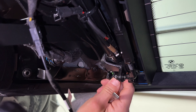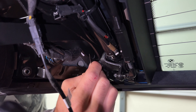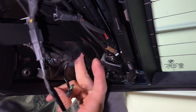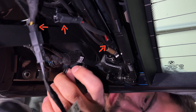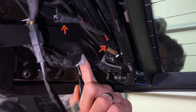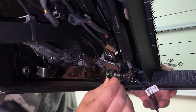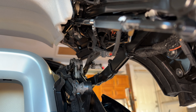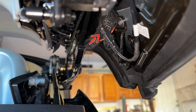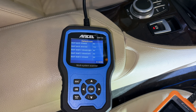What I didn't realize at the time — and some of you have surely noticed it already — is that when I tested the switch, I had plugged it into the wrong connector. The connector I used is actually supposed to be connected to the micro switch that tells the car whether the roof is stowed or not. Once I figured out that the correct plug was more hidden behind the wiring loom and plugged everything in correctly, this revealed that the switch might not have been the problem this entire time — but at least now I know how to replace these micro switches.